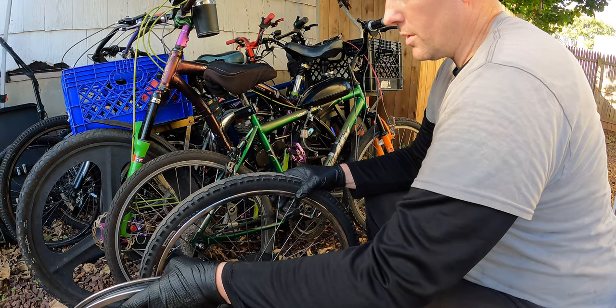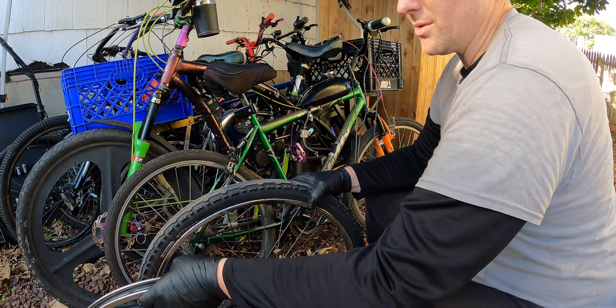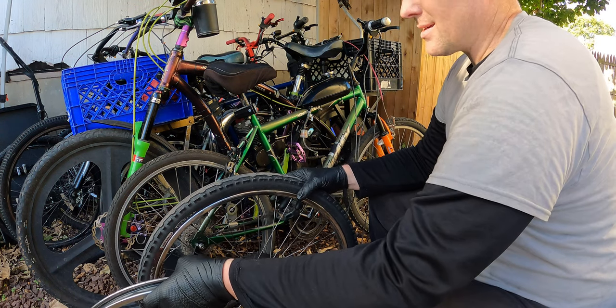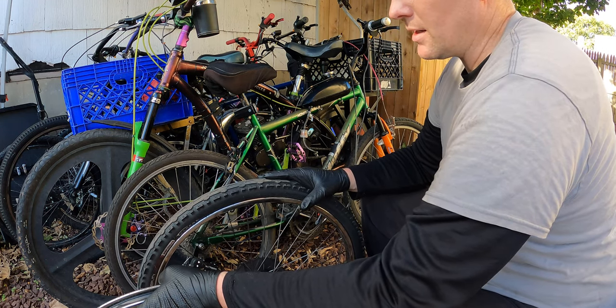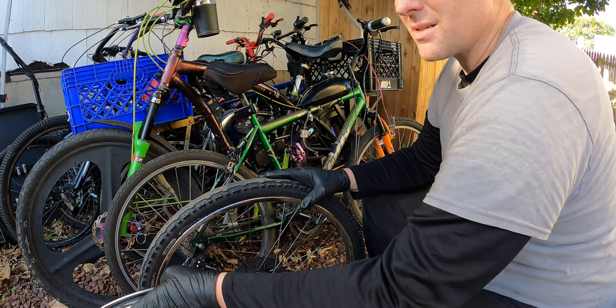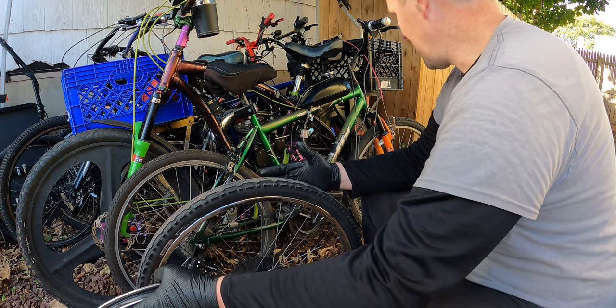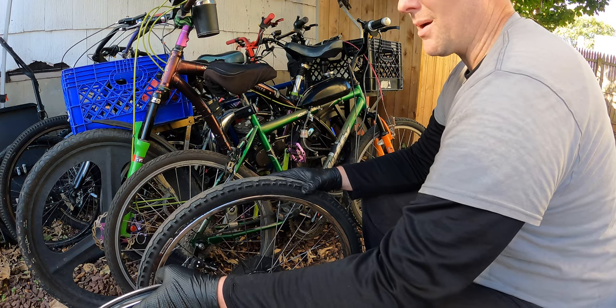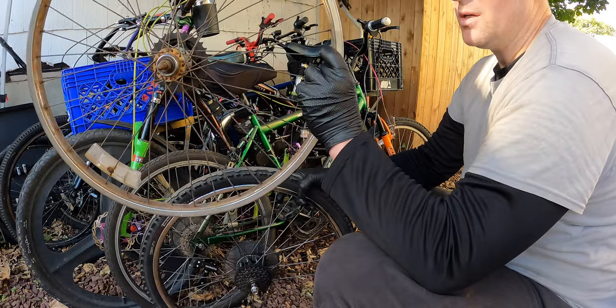He loves spoked wheels because he thinks they're stronger than mag wheels. I've never had to fix my mag wheels outside of blowing axles. And since I rectified the problem of over tightening the cone nut after tightening the jam nut, I haven't had to fix an axle either. So to say simply, 100%, if you're gonna ride on a daily, mag wheels are the way to go.